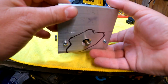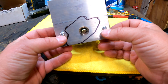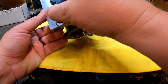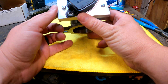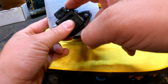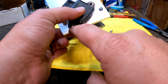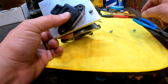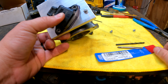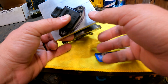I got my two holes drilled and they line up excellent. Got a couple of screws — this is all I can get this late at night at Lowe's — and this is going to hold it in place. My TPS, I've already traced it and it's going to go just like that. I've already used my center punch and center-finding punch and punched it. We are going to take this tap and die set, drill it out, and tap it to M5 by 0.8, and then this should thread right in.